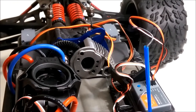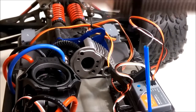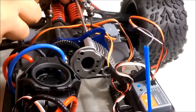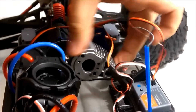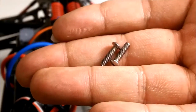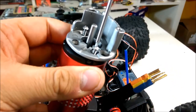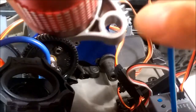Here I'm going to show you a quick installation of the motor. What you'll need is a 2.5mm hex and also a 2mm hex. Use the 2.5mm for the screw behind the motor mount — unscrew that and your motor mount should come loose. Next, use the two screws to attach your motor to the motor mount, then screw it in.